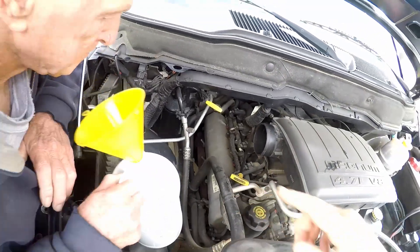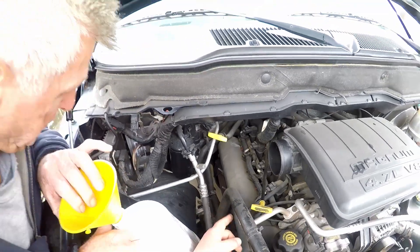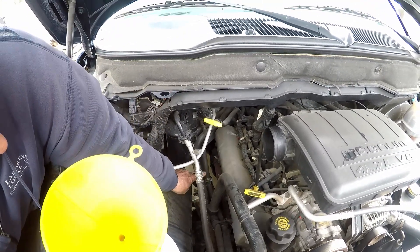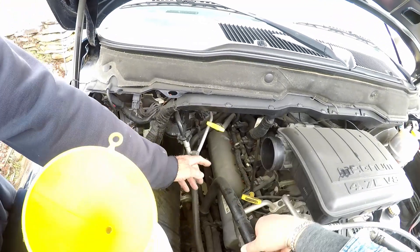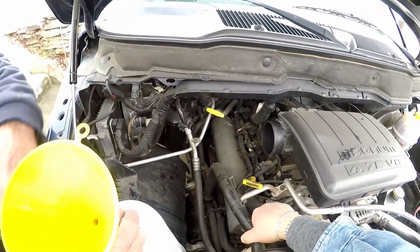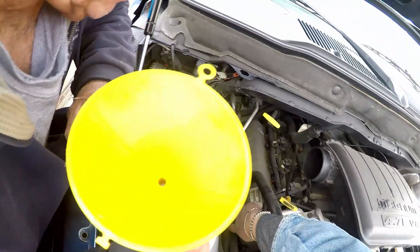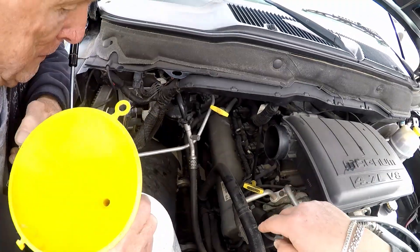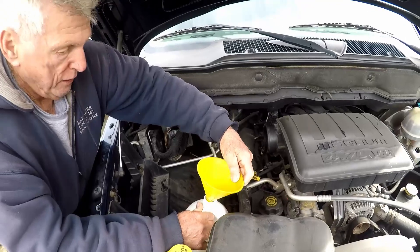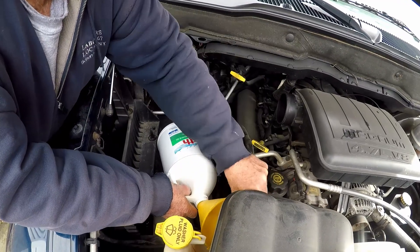If you disconnect this hose and then pinch the other one so it doesn't flow back, then disconnect that one, it'll come right out. I took it off here and here — you don't even need to take the other one off. I hold these up like this and dump the CLR in there and it runs in. You can do it right through this one since you can get this one higher — that's actually better. Pinch the back one off so the CLR can't go that way.